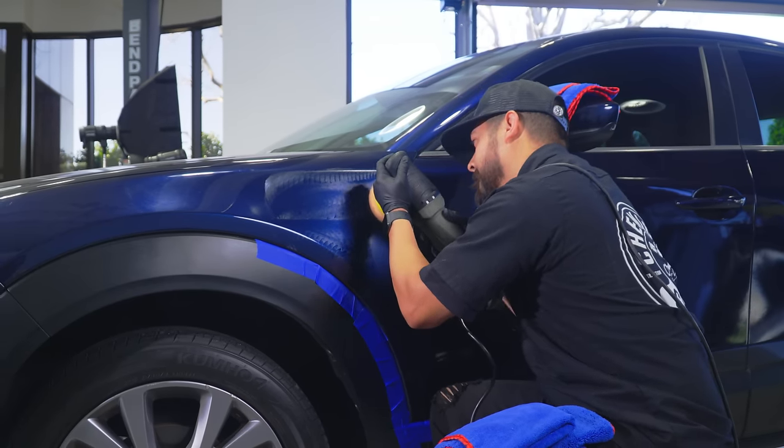At this point of the process, once you're done polishing, you can basically choose to either A, leave it as is, or B, and I would strongly recommend this, apply protectant. If you are gonna go through the hassle of washing your car, cleaning it, and polishing it to perfection, I would say apply ceramic coating, something like Carbon Force, which is a 5-year ceramic coating. If you wanna do something a little bit easier and not as time consuming, you can do something like our Hydro Slick ceramic coating, Hyperwax, which is a great alternative and will last you up to 12 months. And if you wanna do something quick and on the fly, like how we have right now, I would honestly say just spray some spray sealant on there like V07 and call it a day.